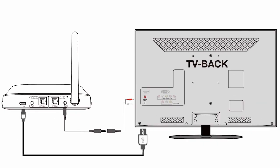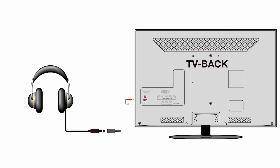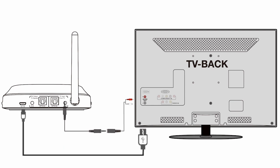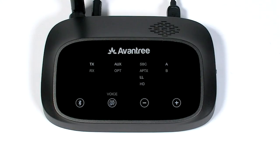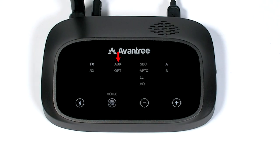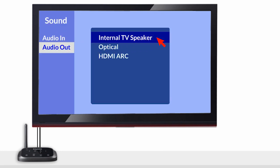Finally, we'll talk about the RCA port. For this option, please only use the ports labeled Audio Out — the other ones will not work. Connect the RCA to AUX converter cable provided to the auxiliary cable, also provided, and then connect your TV to the transmitter using that. You should see the AUX indicator on the transmitter light up. If it doesn't, simply press the AUX OPT button once. Now you should be able to hear your TV through the headphones. If not, check your TV settings to make sure your TV speaker is set to external speaker.